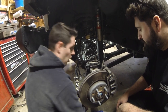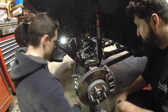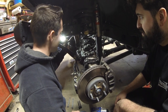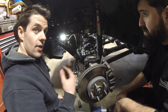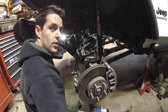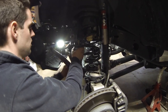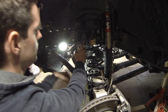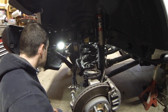You've got long bolts from the front and short bolts from the back — you can't mix these up. Make sure the long bolts stay in the front for the steering box and short bolts stay in the back; put them on the ground in the same manner. Your steering box is going to drop a little bit, which is kind of scary, but if you wiggle the pitman arm you can lift it back up. Now we have to slide the brace on and re-thread the bolts through — it should just go right on like this.